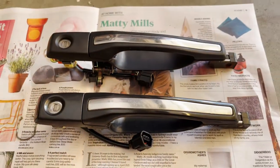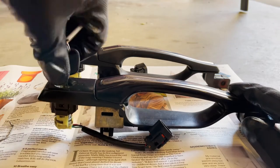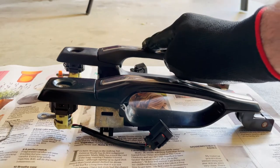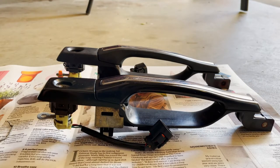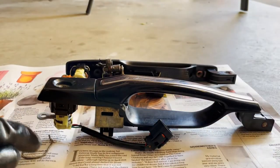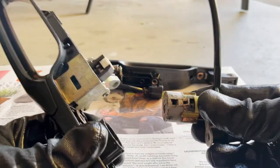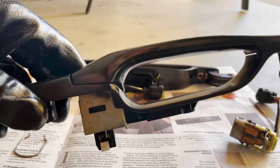With this handle that I'll be fitting, the key works fine in the barrel. The other barrel doesn't work — I suspect there's a jam because the key won't go all the way in. In theory it should because these handles are off the same car. But if for whatever reason you need to fit the original barrel onto your replacement handle, they come out quite easily. There's just this horseshoe clip here which pops off with a screwdriver, and then once that clip is removed the barrel slides straight out.